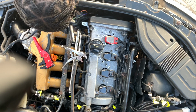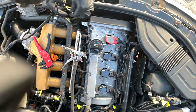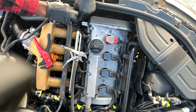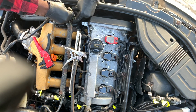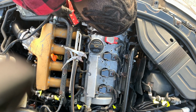And the reason why you're doing this is because you're trying to protect the wire from corrosion in the future. So that's why you're trying to heat crimp these other pieces on. So let me go ahead and get the other one in. Let me go ahead and flip a little bit of it.